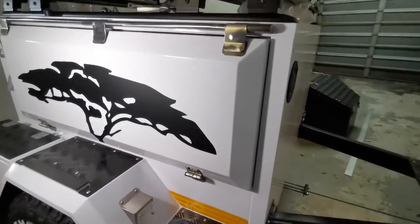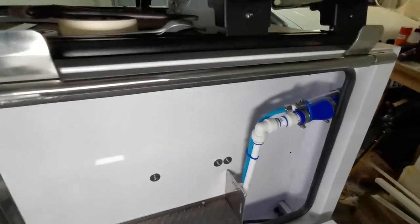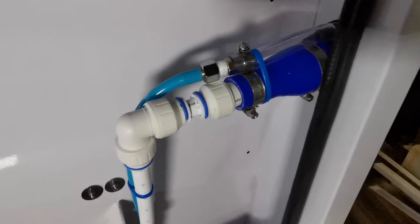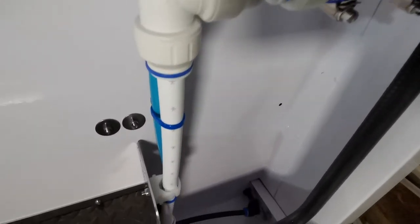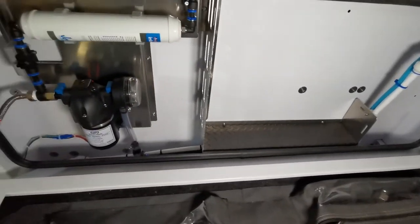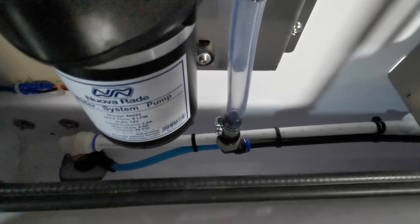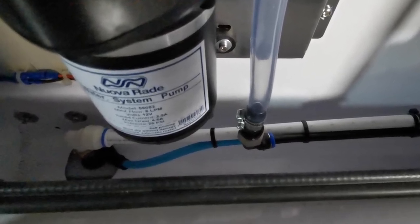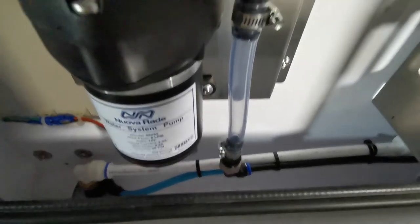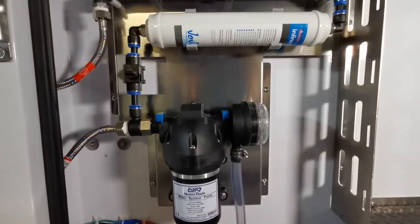Here is a quick rundown of how the system works. Everything is housed inside the right-hand side compartment door, so on opening that door the system is in front of us. From the filler tube on the top right, the dark blue pipe is the reducer. The light blue pipe coming down is the air pipe for the tank to the filler. The white pipe coming down is the inlet pipe going to fill the tank. In the bottom corner, the black pipe coming out of the bottom of the trailer is the inlet pipe to the pump, taking water from the tank back up to the pump. We also made a small aluminium shelf there just to protect those pipes when loading other items. The light blue pipe goes into the trailer to the top of the tank as the air breather, and the white pipe goes into the tank as the filler connector. You can also see the electrical connections running up to the pump.